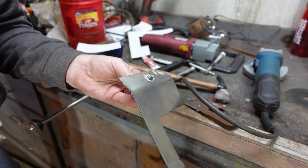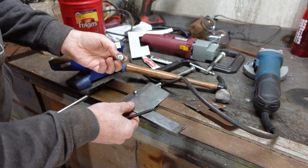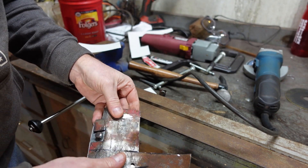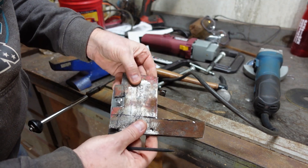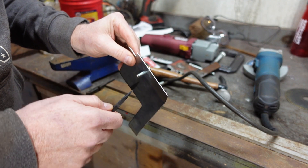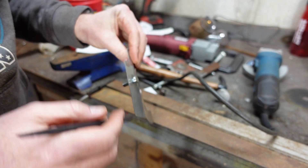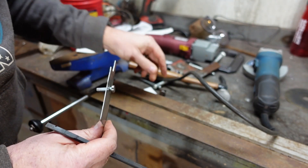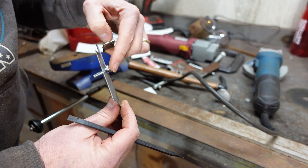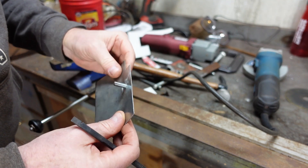I was somewhat able to reproduce that stud post. Here's the original one that I cut out — I essentially just lined it up to make sure that it fit in about the right spot, and it does. I just took a quarter-28 bolt, shortened the length a little bit on the grinding wheel, and then rounded this off on the grinding wheel as well. So it's not quite as big around and it stands out a little bit more. I could probably take the flap disc and try to take that down a little bit, but I don't think I'm going to worry about it.